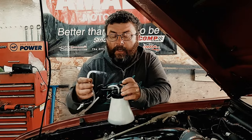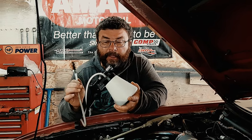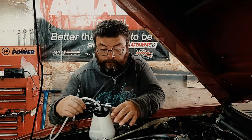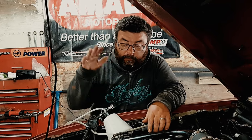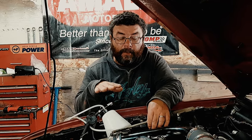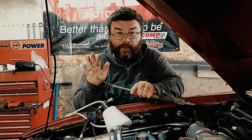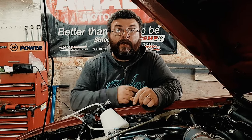I'd like to add just one more thing: when bleeding with this, I never like to depend on the vacuum bleeder alone. I always like to go back after it's bled out and do buddy bleeds. So that's the tech tip for reverse bleeding your brake system to reset your proportional valve. I'll leave a link in the description — the vacuum bleeder is the much gentler, preferred method of reverse bleeding the brakes. The blow gun is a little more aggressive, but if you're in a jam, it may get you out of a pinch. That's going to do it for this edition of This Guy's Garage — hit the subscribe button and watch another video.